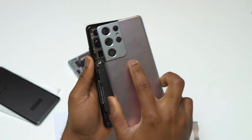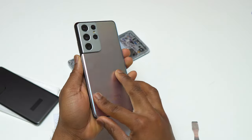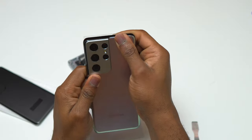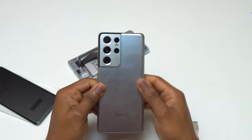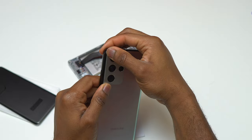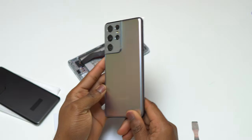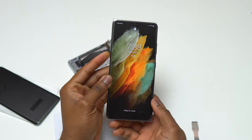You can reinstall your old back glass if it is not broken — you just need to apply a little bit of B7000 on top of the double-sided tape. If the double-sided tape is broken and cut all around the back cover, you can watch the video on screen for the back glass replacement on the S21 Ultra — I did both with B7000 and with a new back cover. Subscribe, like, and share, and I will see you next time.